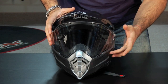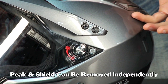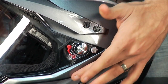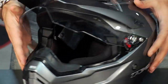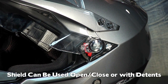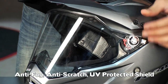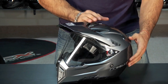Moving into the shield mechanism, you'll notice a nice feature for this dual sport helmet — your peak and your shield are separate. Some dual sport helmets on the market use the same bolt system, so removing the peak affects the shield. With this one, you can pull the peak off and it comes with covers for the screw holes, without affecting your shield at all. There is an adjustable shield with four detents. Two connector pieces come in the instruction manual packet — you can replace these so the shield is either open or closed, or you can have a couple of strong detents in the middle. It comes stock with the detents on. The shield is also anti-fog, anti-scratch, and anti-UV — a very protective, distortion-free shield that will last a long time.